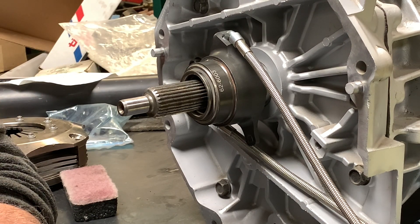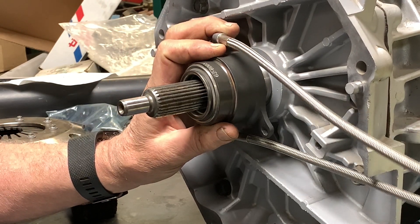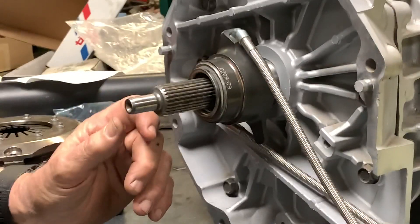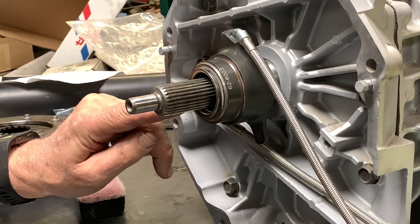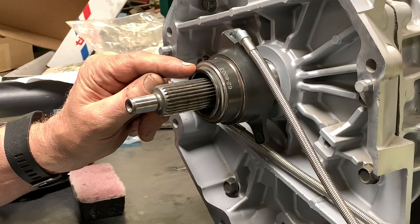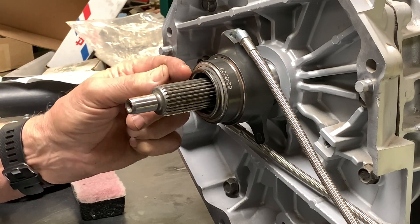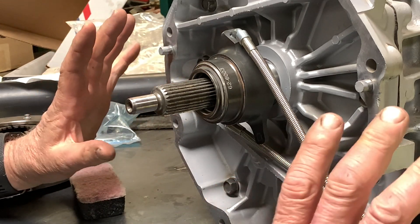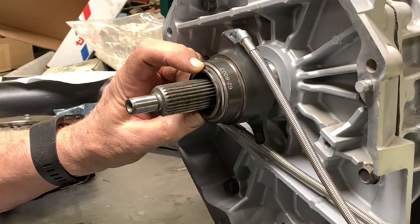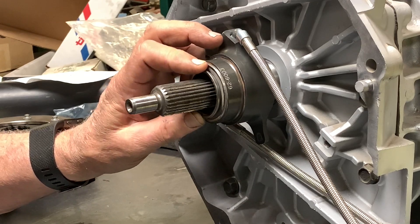If you're going to scrounge around on eBay for parts — clutches, flywheels, that sort of thing — there's something you need to know about hydraulic throw-out bearings. They all look pretty much the same: a hydraulic ram, an alloy case, a couple of lines. But this edge right here is going to be different for different types of clutches. For a small-diameter Tilton or Quartermaster clutch, as the clutch fingers travel, this edge must have a certain radius — and that radius is different than for a large OEM-type 10.5 or 11-inch clutch. If you don't have the right radius throw-out bearing for your clutch, you will ruin the bearing face and the fingers on the clutch — guaranteed.